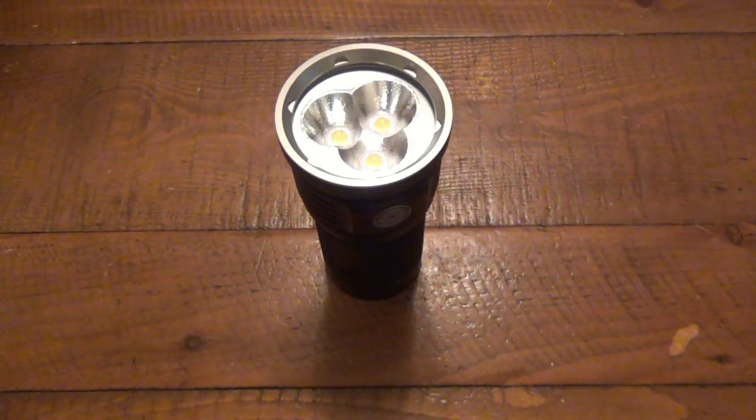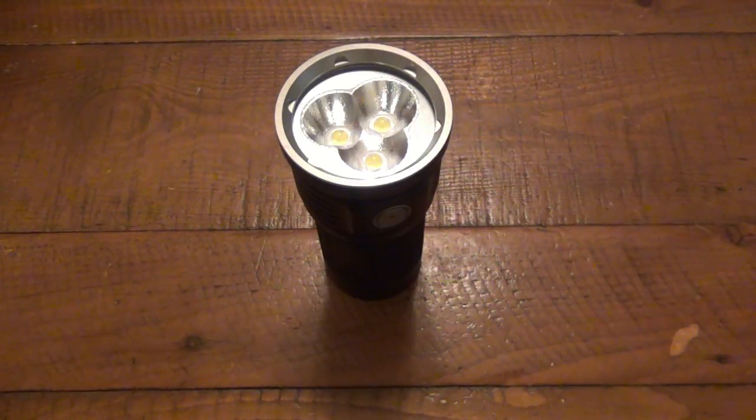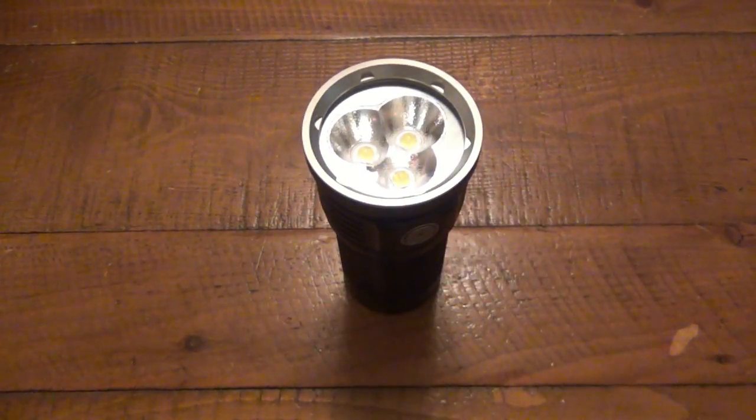Headlights on a common car, and obviously there are a lot of variables there too, and newer cars usually use brighter lights. The average low beam, I think, is only like 1500 or 2000 lumens. Even on a bright set of headlights, your low beams are probably 6,000 lumens at most. Your high beams are still under 10,000 lumens. So this is literally brighter than getting in a pretty new car and putting on the high beams.